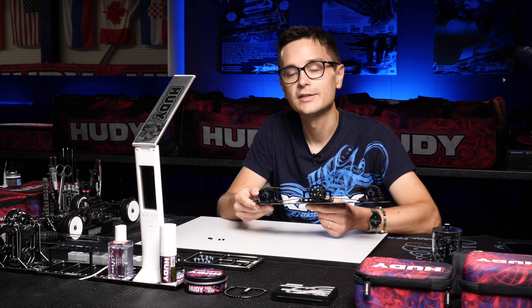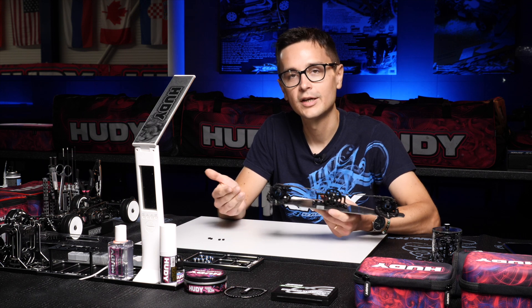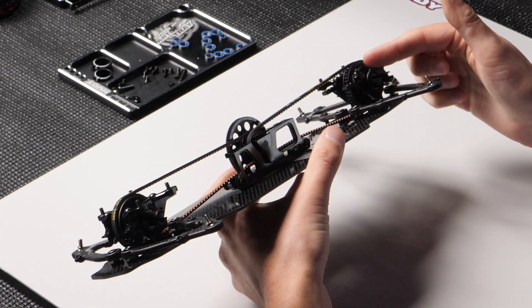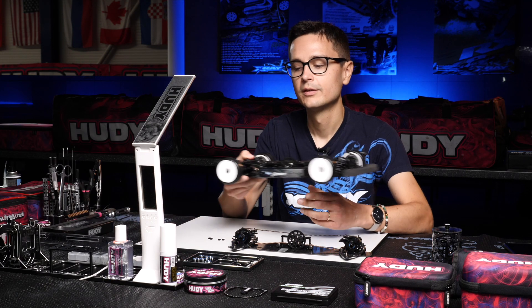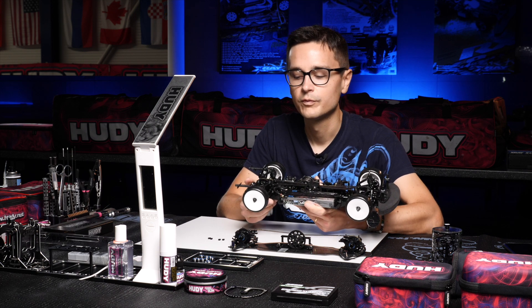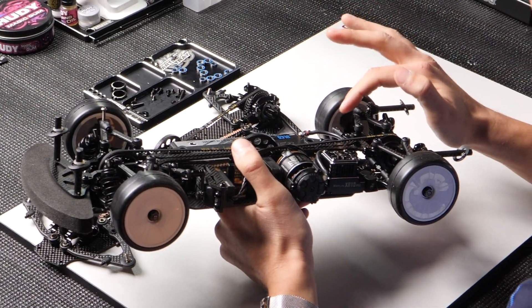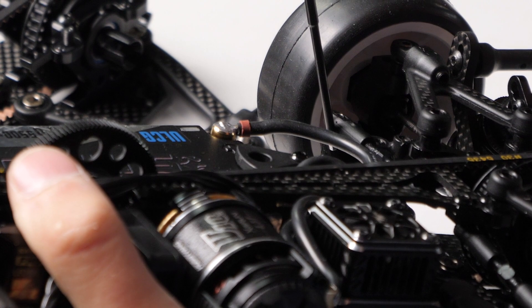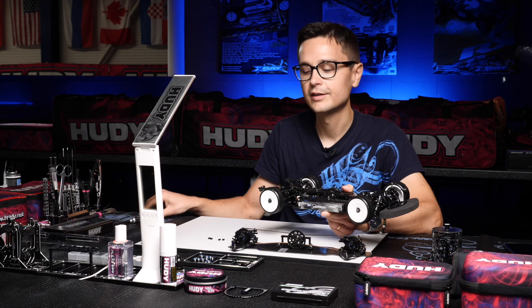For racing conditions or whenever we need to make the car more aggressive, we use more rear caster — as much as 2.5, 3.5, even 4.5 degrees sometimes. Not only do you make the rear wheelbase shorter with more rear caster, but you also change the rear toe gain. When you use more rear caster you need to add shimming to compensate for the rear toe gain — 0.5 mm per degree of caster that you change. So the caster also affects the rear toe gain setting.